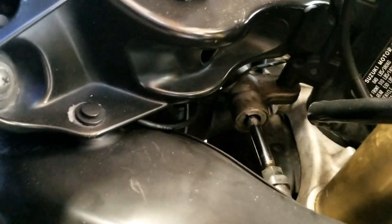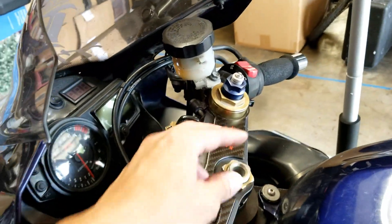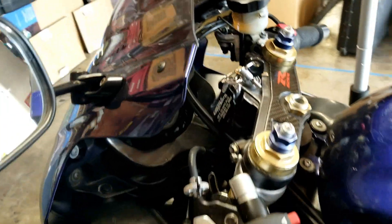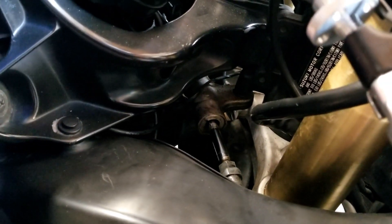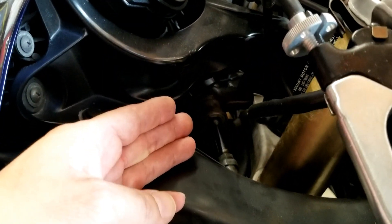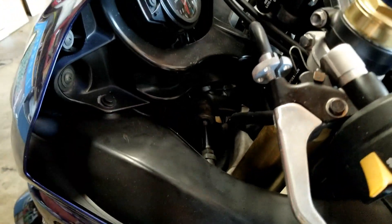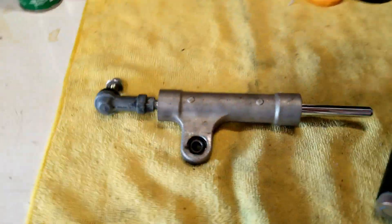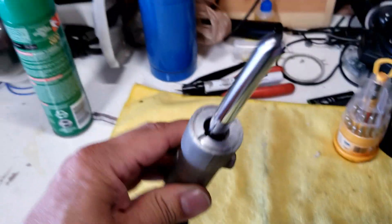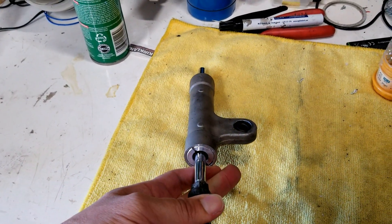Third and the most likely cause is the steering stabilizer. This is the OEM one, located down here in the bottom of the triple tree area. My bike has probably over 120,000 to 130,000 miles on it and this has never been serviced or replaced. I purchased a replacement from a yard which is in pretty good condition - no leaks - and the movement when you slide it is nice and stiff, silky smooth, with no fail points at all.